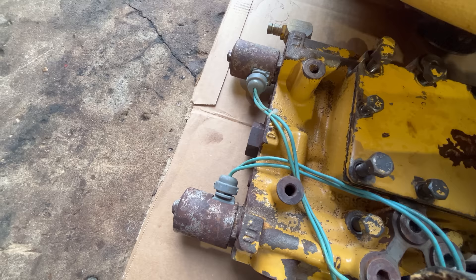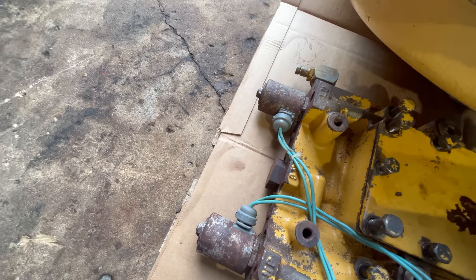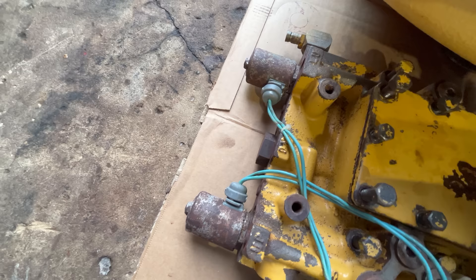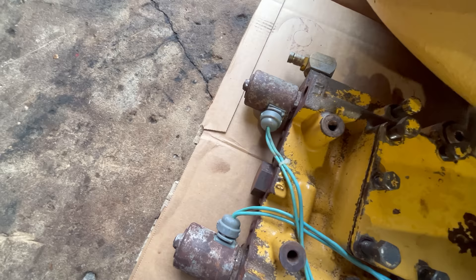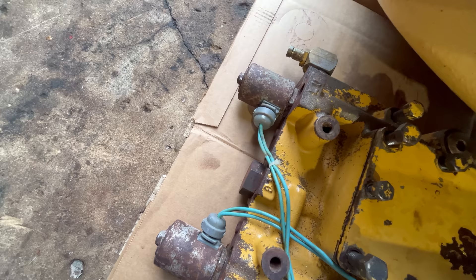I didn't explain this very well, and I wound up with a bunch of comments saying that's the LU port, it's for torque converter lockup, the solenoid's there to port oil to the clutch to lock it up. Normally they'd be correct, but in this case they're not. In the D400E Series 2, the LU port is not used — it should just be plugged. The solenoid should be in the DN port. Long story short, the solenoid should not be in the LU port. There's no reason it's there other than somebody just put it there by mistake.